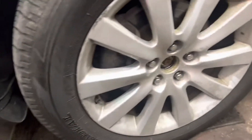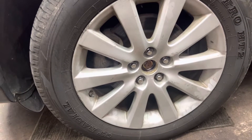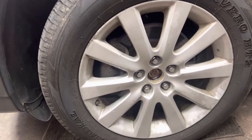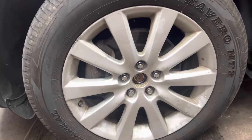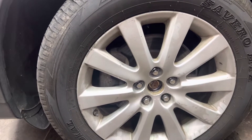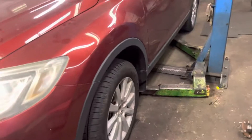The next thing I want to tell you is something I could not find anywhere until I read through about 35 posts, three videos, and comments. The axle nut torque spec on this is 174 foot-pounds minimum, 202 maximum — so you've got a little range there. When dealing with hub bearings, I usually go to the minimum, because the more you press on it, the more you squeeze it, and the more it's going to wear out. So again: 174 to 202 ft-lbs on a front hub bearing, Mazda CX-9, 2007 — could be 2008 — same body style.